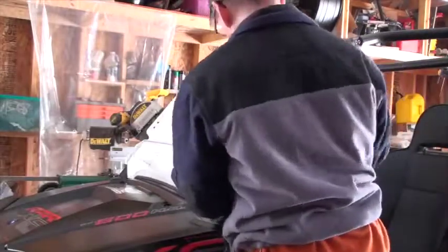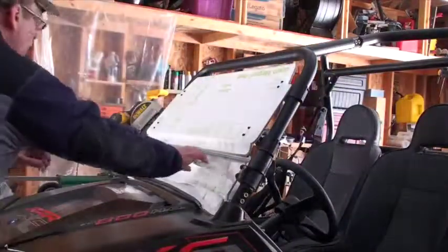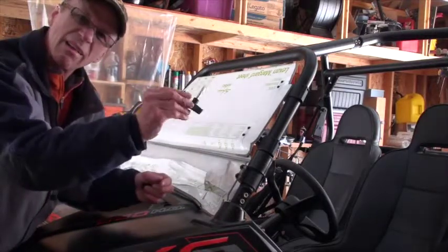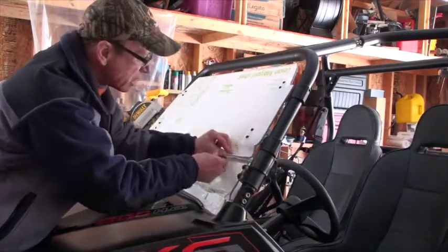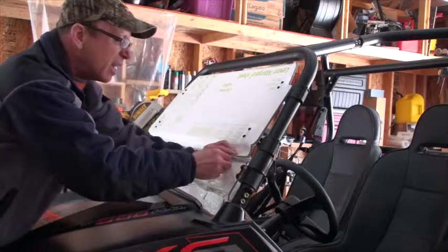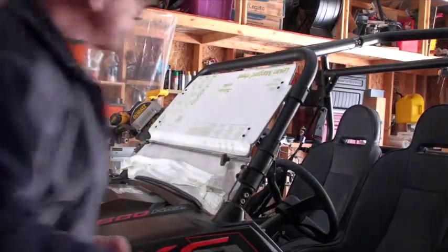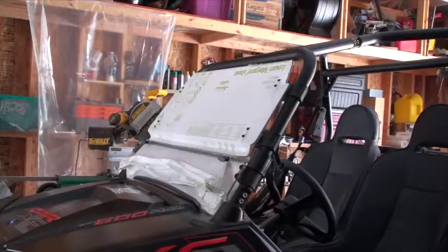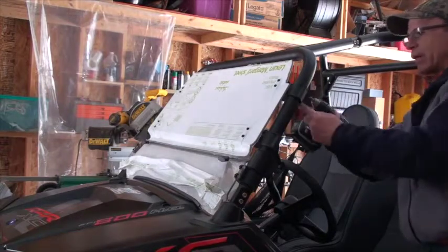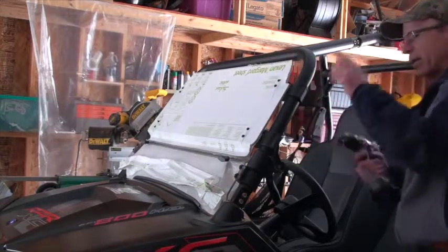Okay, well, there it is. Now I think they said something about keeping a gap down here, like a quarter of an inch or so. So my guess is these little guys, the wing nuts, the lock nuts, will probably suffice. One in there. That looks pretty doggone close right there. So now I think I can tighten down that top knuckle up in here. And by the way, make sure that you put these on so that the Allen is on this side. If you put it on this side, you won't be able to tighten it down. I'm only going to tighten the top one right now.